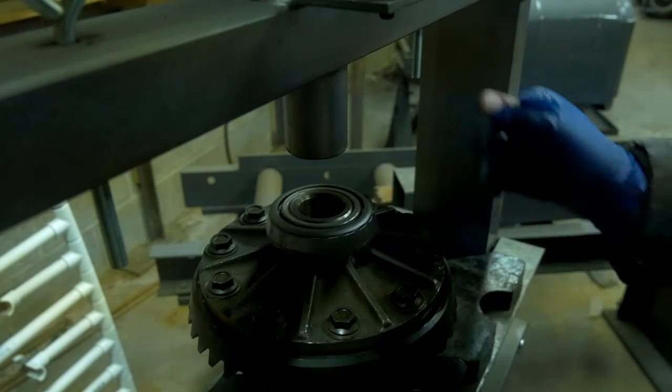A little bit of grease and then just tap it in place. There's little bitty circlips inside the carrier. So if you're having problems getting these to drive all the way down, make sure you're not bending the circlip, or that the circlip is not worn out of spec to where it's kind of blocking everything. So recenter it and then drive it all the way.